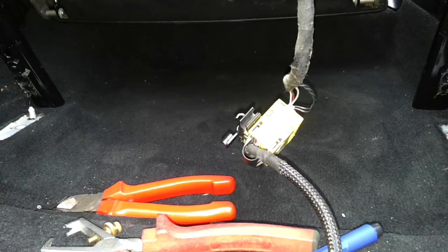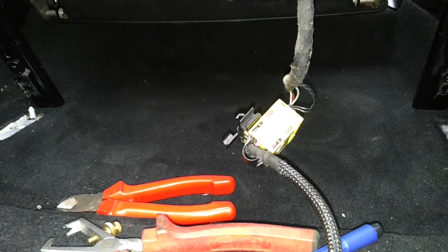I went online and had a look through some of the BMW forums, and there were people saying you couldn't do that — you had to take the belt tensioner off the old seat because there were two different airbag control systems that were incompatible. So I decided this morning, before going down the road of tearing out the seat and doing all that, I plugged in the computer to see what errors were in the airbag system.